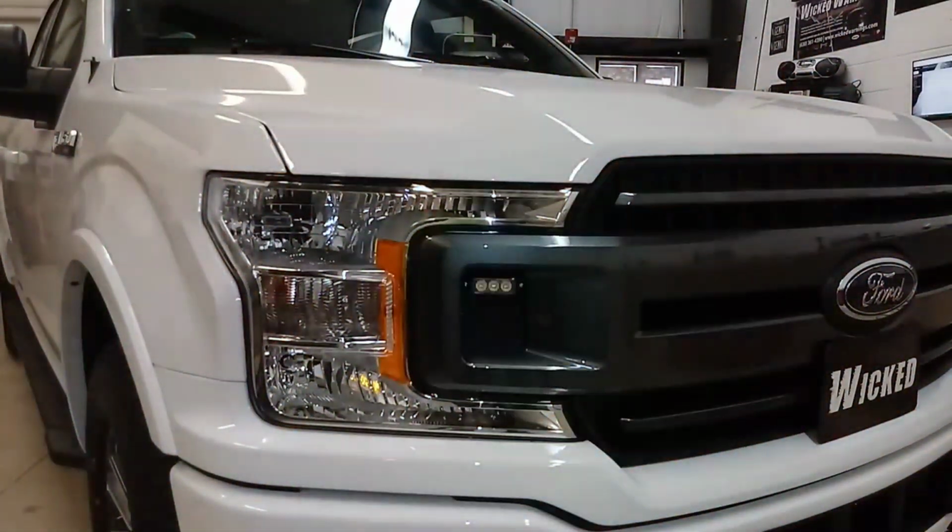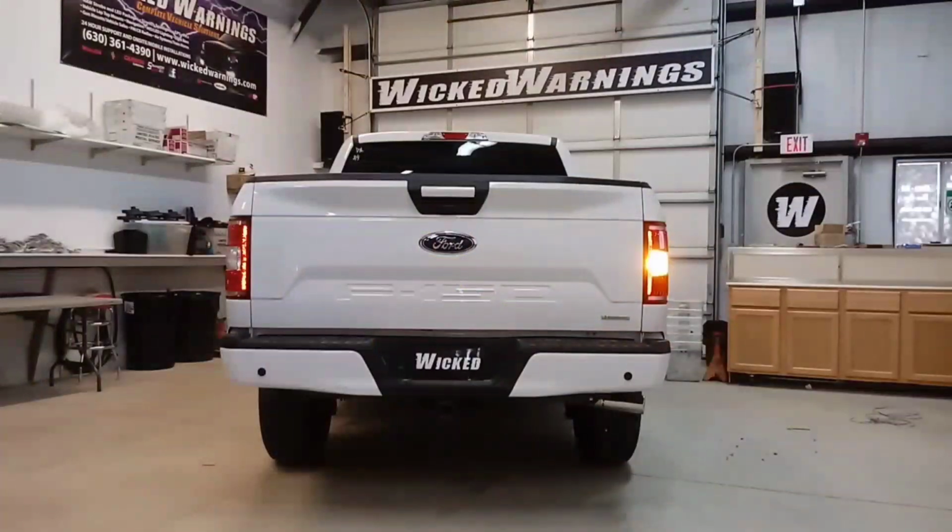I'll spin this around and show you the LED duos in the rear. Here out back, you can see our use of the LED HAW Duo. It fits quite nicely coming in from the side on these newer reverse lenses. Fills the lens with a bright amber light. This is the amber, and I use the HD version in these F-150 taillights. A simple 1-inch hole and a little RTV sealant is all that's required behind there.